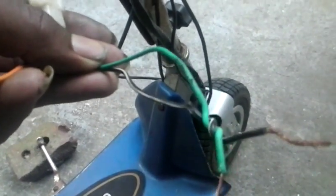I cranked it one time and had to figure out the wiring diagram on it. The orange and the yellow wires are to turn on the power to the scooter. And the green and the black and white wire is the kill switch.